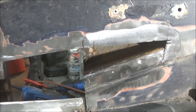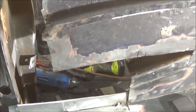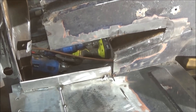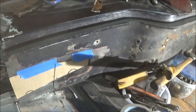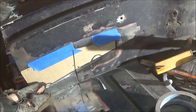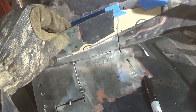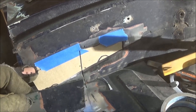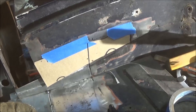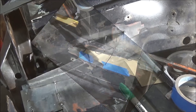I think we're ready to go back to replacing this flange here — maybe a piece all the way across. It's definitely slow going but we're making a little bit of progress. I've got a template in here for a patch to cover this area, with these little funny cutouts on the bottom which I've noted. This patch needs to be a little bit longer, but then we're going to go ahead and scribe it out on the metal and see how it fits.